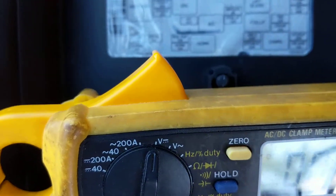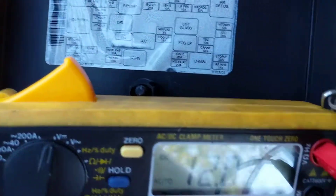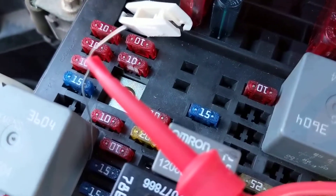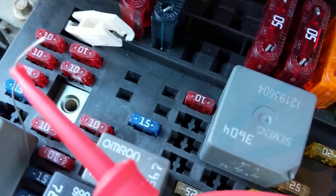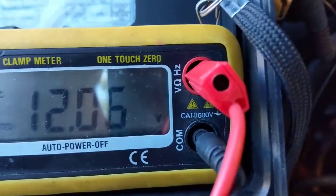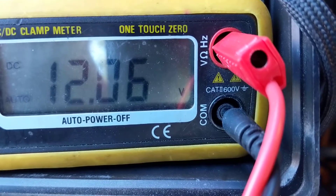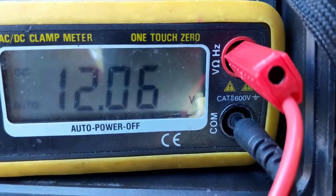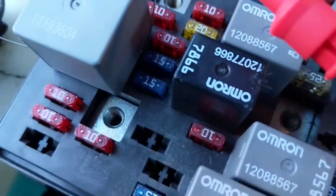That's the other side of it — 12.06. So I know the relay is working. How do I know? Because I went to the other side. This was the B+ side; this is the output, or the load side of it. That tells me the relay is working. The 12.06 tells me current is being drawn, there's a complete path to ground, and the relay is active — because if not, it'll go back up to 12.4. That's why I always teach current. You can test the relay in-circuit, and it's the only proper way to do it.